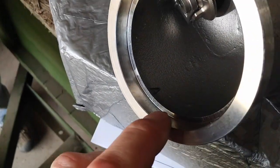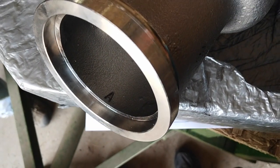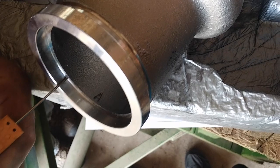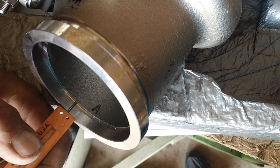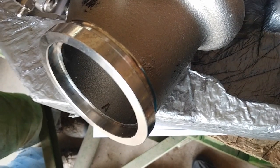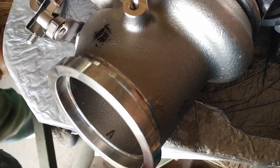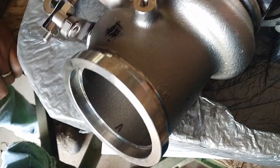One last thing — don't make the mistake that I did. There are two different part numbers for the replacement turbo, and the difference between the two is the depth on the flange where it bolts to the catalytic converter. For the later models, you have a depth of around 4 tenths of an inch; for the earlier models, it's less than half that. So measure the gap before you order your part. Unbolt the catalytic converter from the front, remove the two retaining bolts underneath, and move it up just to get a measurement on the depth of that flange.